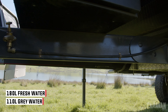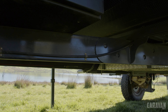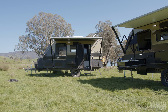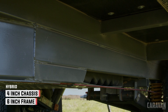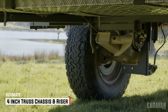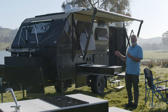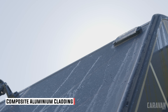The Legends are really tough, built in the Australian tradition of off-roaders with an aluminium frame. The logo on the back says it all. It's a high-tech aluminium frame and it's special because it's Huck-riveted, which means it doesn't have to worry about the frame cracking if it's welded and it handles vibration really well. The frame itself is Huck-bolted to the chassis, which again means that vibration over really rough tracks isn't going to be a worry.